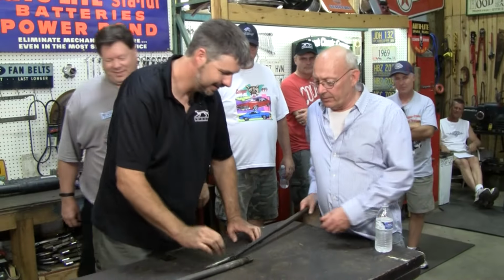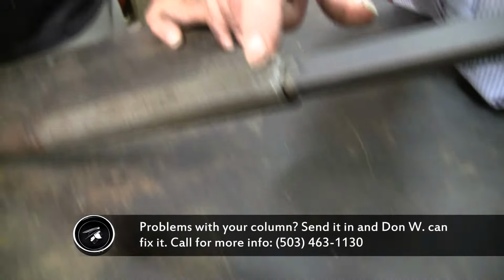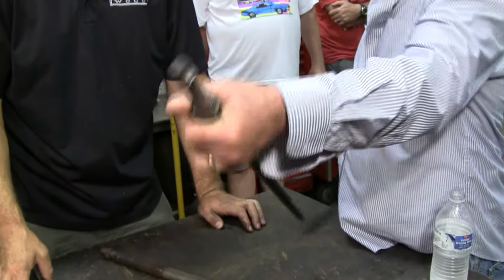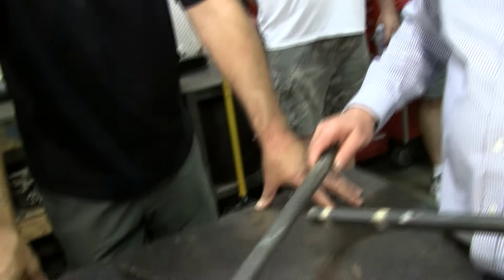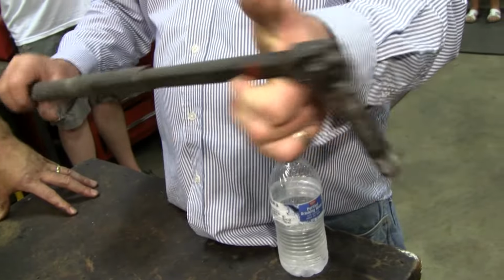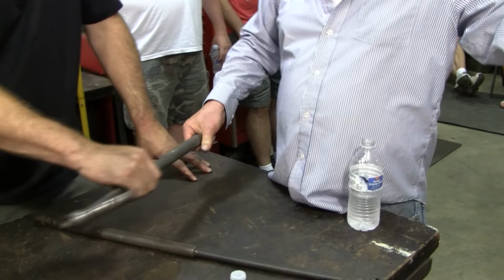This one, you can see real close, there'll be two, looks like pins, and they're just plastic. And what they did is, like on this one here, you have a plastic piece there, two of them, and there's pins there. And you can see it come out the other side on here, and that would collapse. When most people put these in, or try to put them in, they put them in wrong, and they'll hammer on it a little bit, and they'll break these. And try and put them back in, and try and tighten them up a little bit because you get the slop here. And now transfer to your wheel, and now I'll actually put maybe one to two inches on your wheel where you'll feel the vibration.